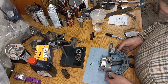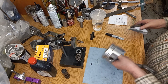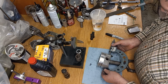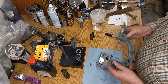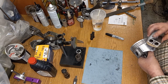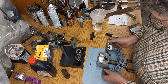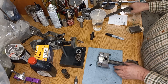Okay, we're at 2.5 now. To be exact, 2 7/10. So I'm going to sand it just a little bit more. Going to stay on top of my knurl. Okay, I'm at 2 4/10. I'm probably going to give a little bit more sand right on this side here. I'm going to call that probably pretty good. Yeah, I'm going to call that good. A couple tenths away from 2. I'd rather have it a little bit big. It will wear in a little bit.